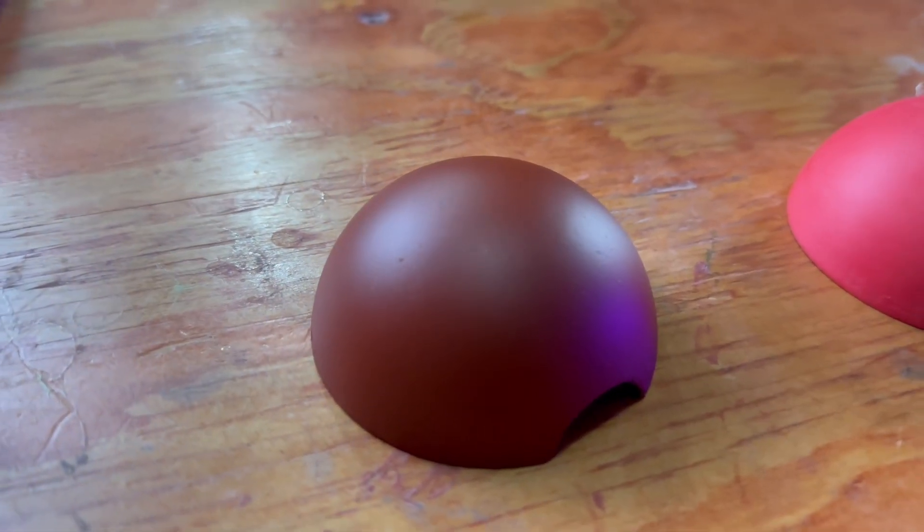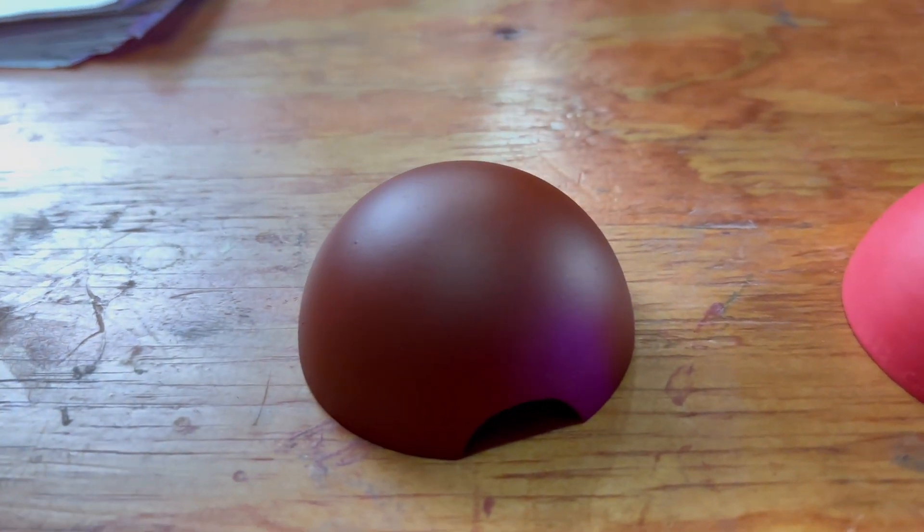I just finished the non-primer one with 220 grit sandpaper. For the control, after hitting it with acetone and bondo, I sanded that down with 220 grit sandpaper. Then I went ahead and used my filler primer — a thick heavy coat. I did such a good job sanding it that I don't need multiple coats. I'm going to wet sand it down with 220, then hit it with a second pass of 400, and then it will be ready for paint and almost finished. This one, on the other hand, we've got to do some more sanding.